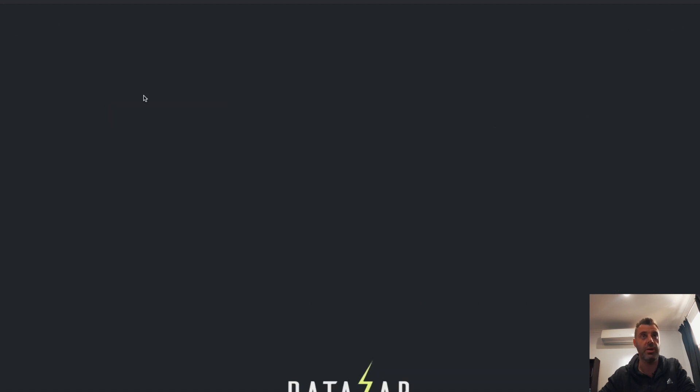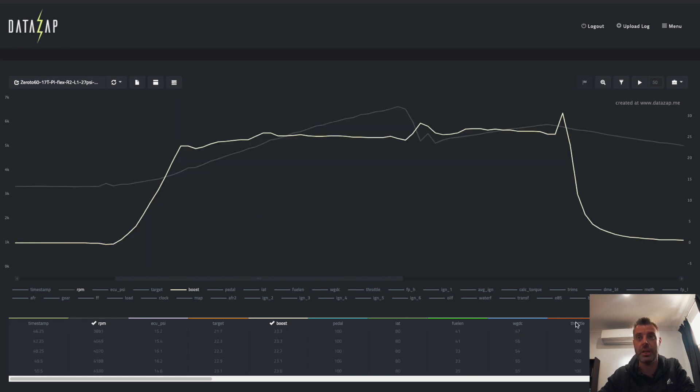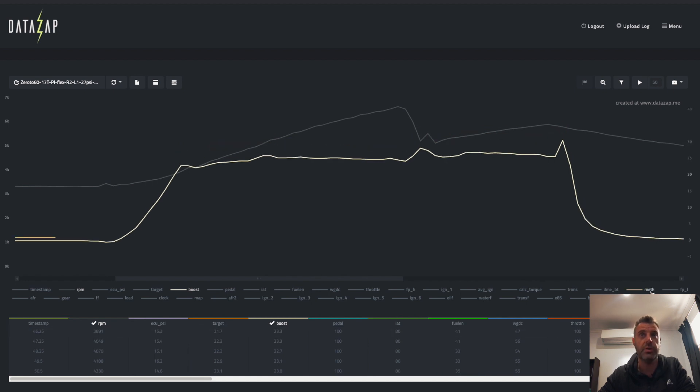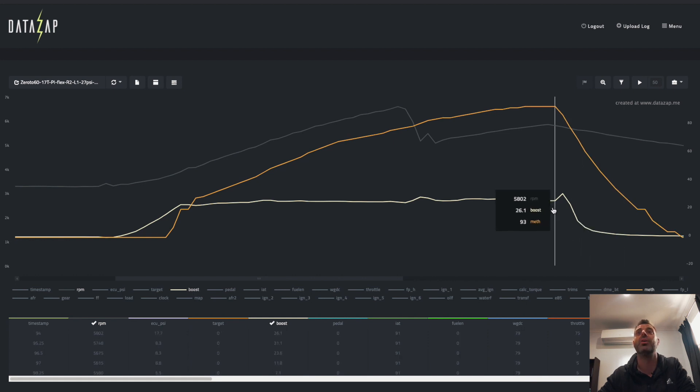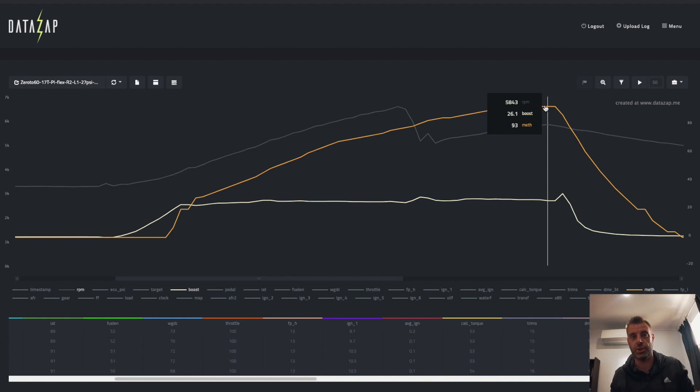Let me show you guys quickly. This is the map we ran for roll racing the other night, data logs at 27 psi — the same map, just with different e-content and boost levels. Bringing up the Meth trace, which is the port injection flow — it was flatlining when we had E25 in the tank. With E60 we're running the port injection — this is in top of fourth gear here at 93%. So big difference. The port injection scaling is definitely working. The flex side of the car is all working as it should. Just need to speak to JSR about the timing. It wouldn't surprise me if it's something he built into this test map so the pump fuel doesn't cause any problems, because without the octane from E85, you don't want to be detonating.